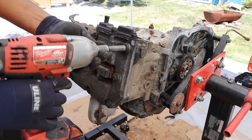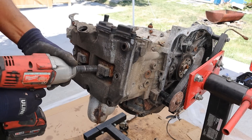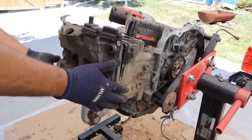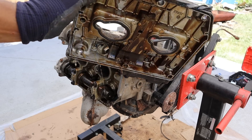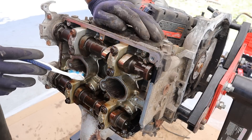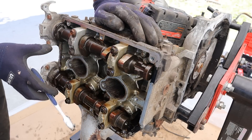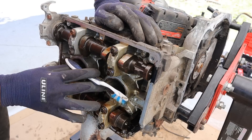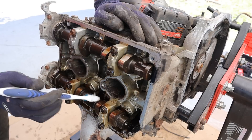Next I'm going to remove all the 10mm bolts that hold the valve cover on the driver side, then pull the coils out. It's really rusty around the top. Now I should be able to pry off this valve cover. Take a look at that — the coolant in the engine actually made it all the way to the valve cover, and you can see some of that milky residue. The EJ series of Subaru engines came in both single overhead camshaft and dual overhead camshaft configurations like this one. In the dual overhead camshaft setup, each camshaft directly acts upon a valve bucket. In the single overhead cam, you have one camshaft in the middle with rocker arms going over to each valve.